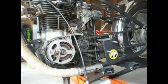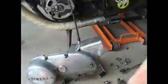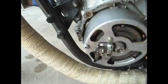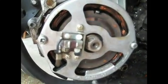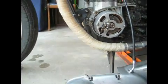You're going to need three 4-millimeter nylon screws. The reason you use nylon and not plastic is because nylon will last longer — plastic would crack as soon as it got hot. There are three screws: screw one, screw two, and underneath is screw number three. The reason we're doing this is because we need to unground your brush assembly.